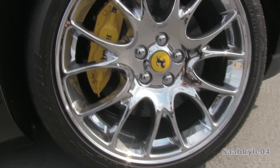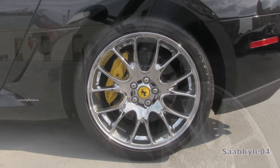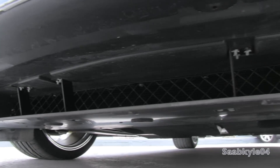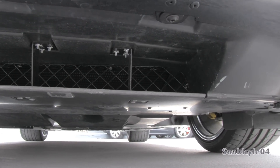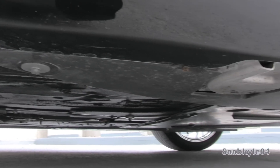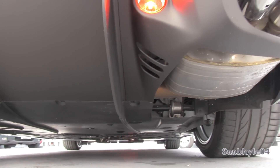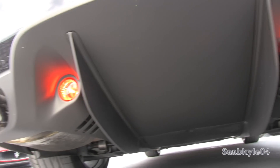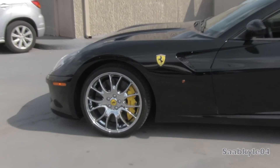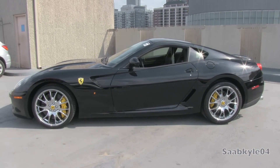The best braking performance is provided by these optional cross-drilled, ventilated, carbon-ceramic Brembo brakes, measuring 15.7 by 1.4 inches in front and 14.2 by 1.3 inches in the rear. Costing an additional $18,550 when new, they provide superior durability and resistance to fade in high-speed, high-demand scenarios. Stopping the 599 from 60 mph is an impressive 105 feet. The suspension features double-wishbone support at each corner with driver-adjustable magnetorheological dampers, coil springs, and front and rear anti-roll bars. Overall length is 183.7 inches, width 77.2 inches, height 52.6 inches, on a 108.3-inch wheelbase, with a manufacturer-claimed curb weight of 3,722 pounds.